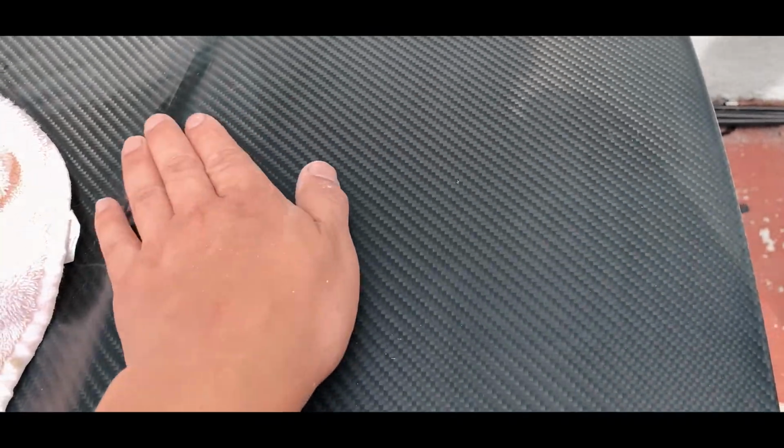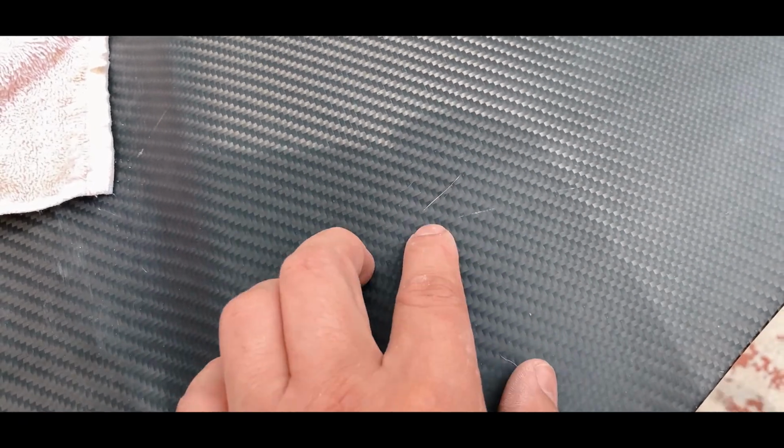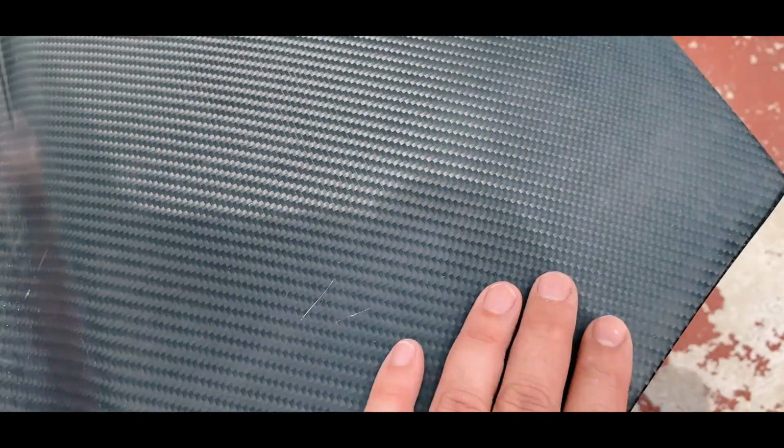So after wet sanding it, make sure the direction goes up and down, kind of like marking an X. Always wet it, always wash it. That way you don't have any debris like a rock or solid matter that will scratch it even deeper. We'll see if I can get rid of the deeper ones too. So let's cut it and buff it real quick.